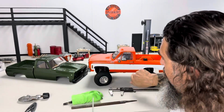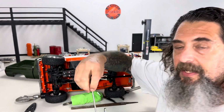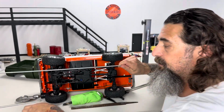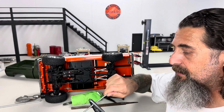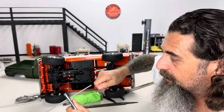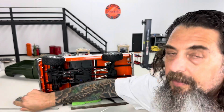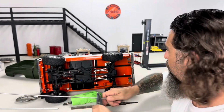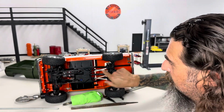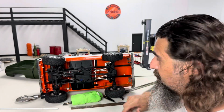Now you can take your stock rod ends, put your rod end on that thread, get it started on there, and you can use those shock pliers again for that. Take the shock plier to hold that threading like this. Get that rod end started on there a few turns, then slide on your brake line, and then you'll put the other rod end on, and now you can put a couple of wrenches or however you normally do it and tighten up those two rod ends until they're snug on that brake line. And then you'll check, make sure they're the same length, and you're basically done.